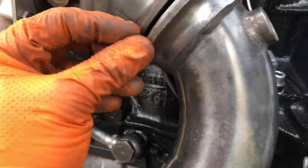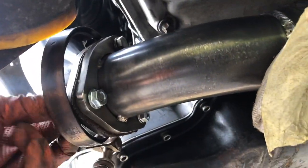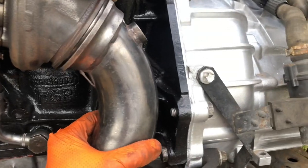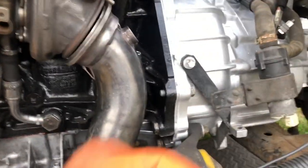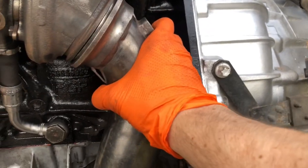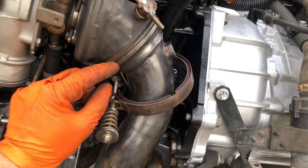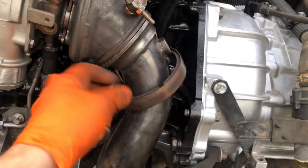Moving on to fitting the decat pipes on these turbos - I want to show you exactly how to do it. You've got that V-band that sits inside the turbo. Everything here is finger tight so you can spin it backwards and forwards. What you need to do is get yourself a stand, cover the exhaust so you don't scratch it, and twist it. You need to make sure that this V-band is sitting flush before you do anything up, with everything nice and loose. Then you clamp the V-band on first, clamp it up nice and tight while everything is still loose, then do up this side, then do up the main bit down in the bottom of the exhaust. Start from the pre-cat end first and that way you're always going to get this to seal.